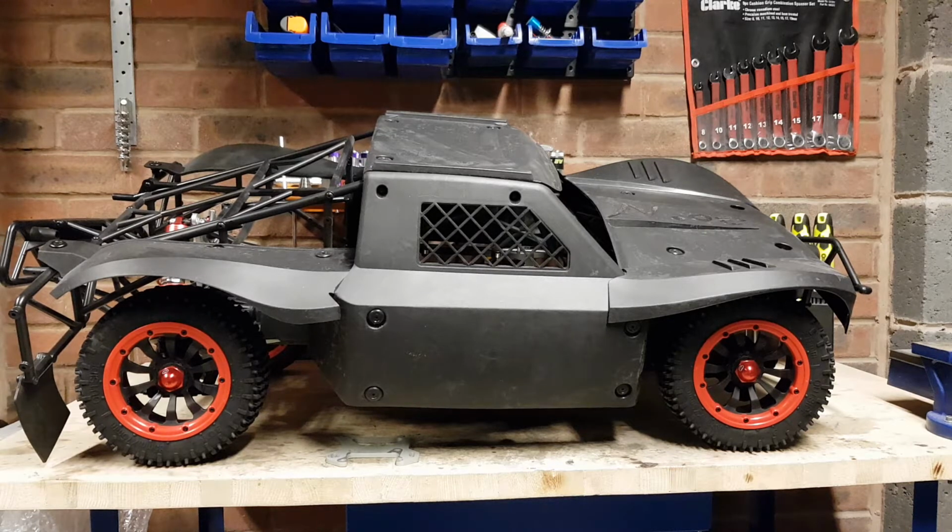A few other X2 problems: servos. They were good, they were strong, but they didn't really like a LiPo. If you put them on 2S, it massively shortened the life of them. This out of the box comes with K-Power, which look identical to X2 servos, apart from the black. But I've been told that internally and component-wise, they use much higher quality components, which is why they're much more reliable. There's also a few guys that I know that go up to track, and they're saying on track abuse, the K-Power servos are holding up just fine, which is a good sign.